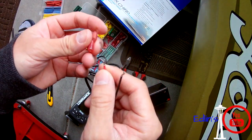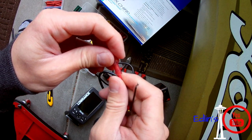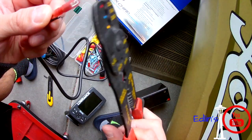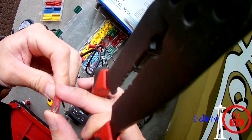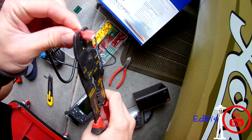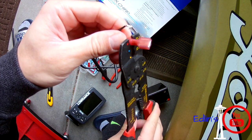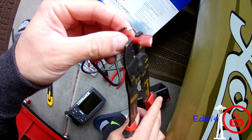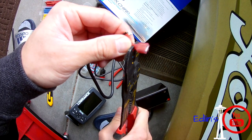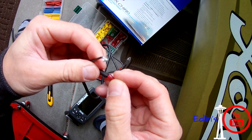Put a little bit of heat shrink wrap on there and your female end. Make sure you get the right wire gauge and butt connector — you want something that fits snug right away. You don't want to have to crimp it down too much. Tighten right here with your crimper, and we'll reinforce it with some electrical tape so it'll be double secure, along with the heat shrink wrap. Just go a couple times along the whole shaft to make sure it's all nice and snug.